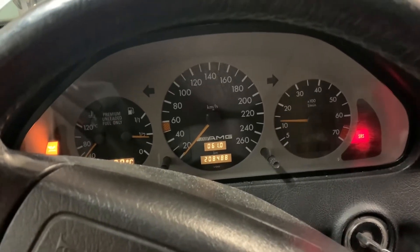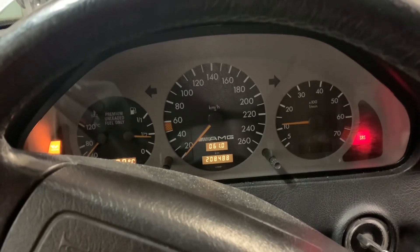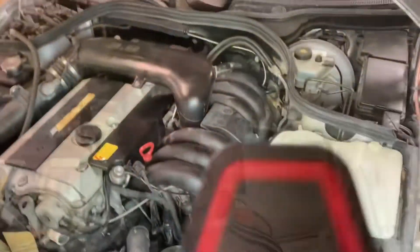Since I have the fuel pump torn apart and all that, I decided I'm going to fix the water pump as well. I think it's the water pump — that little squeak that was coming from the front came back. So we'll replace the water pump. Just four bolts hold the water pump in place, obviously with all the hoses separated. You don't have to take the clutch fan off, but the belt has to come off and we took the fan shroud off as well.